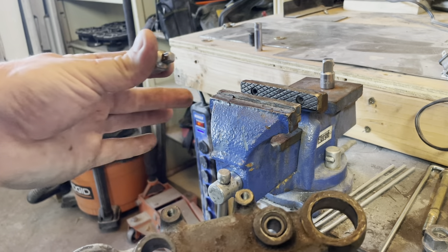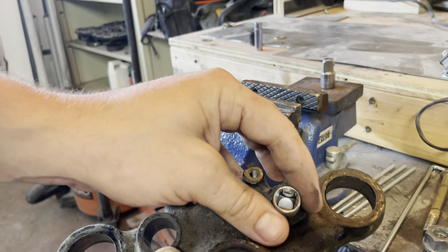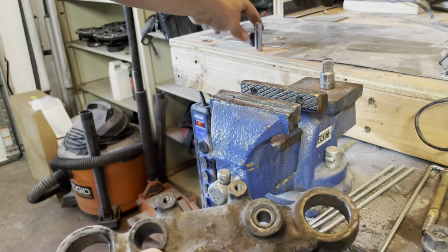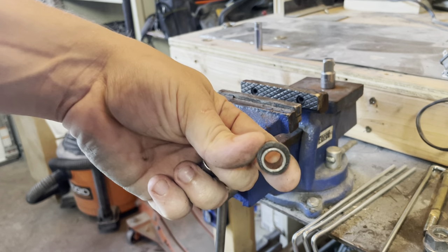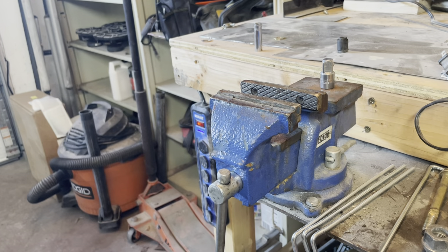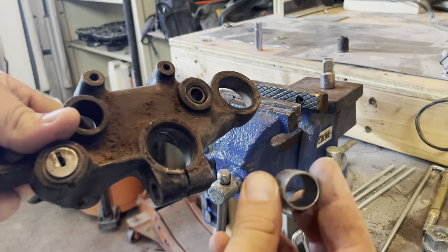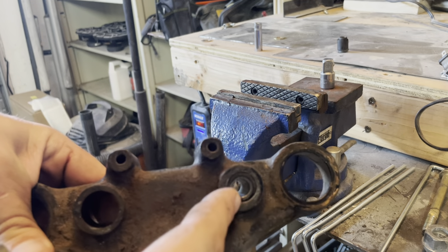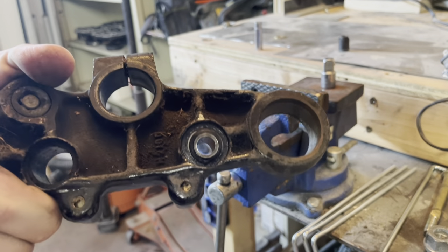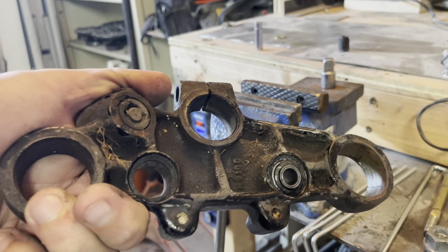The problem I found when I did it this way is that you put this in here and hit it — with the press in my case, but I'm going to try it with a hammer here, and I think that'll work also. It takes the center part out and the rubber part of the bushing out, but there's still an outside sleeve. When I hit it out with the hammer, I think I lost it — it might be here on the ground — and here it is. This part was stuck in there, and you can barely see it, because for some reason the outside ring on the top isn't visible, but you can see it on the bottom. It does come out both sides — there's no lip that keeps it from going one direction or the other — so whatever side is easier for you to hammer it out from, that's your call.